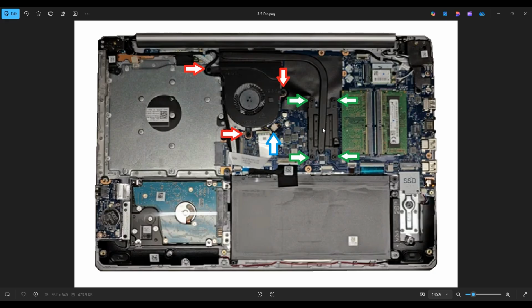One of the things it'll show you is how to clean off all the old thermal paste. You don't want to put new paste on top of old paste. And it will also show you how to reapply the correct amount of thermal paste. If you put too much thermal paste down, you could end up locking heat in rather than facilitating its transport out. And then obviously, if you put too little thermal paste, then you're not getting good coverage, you're not getting heat out. So that video will be below in the description if you want it.